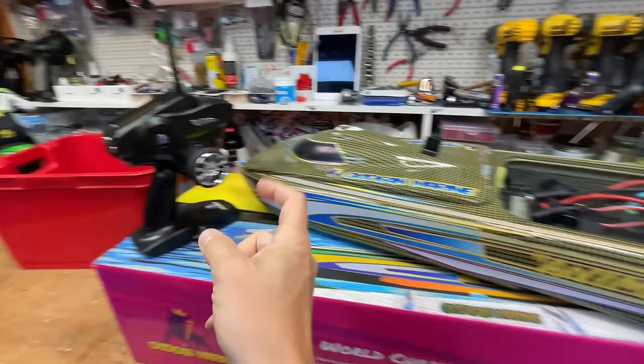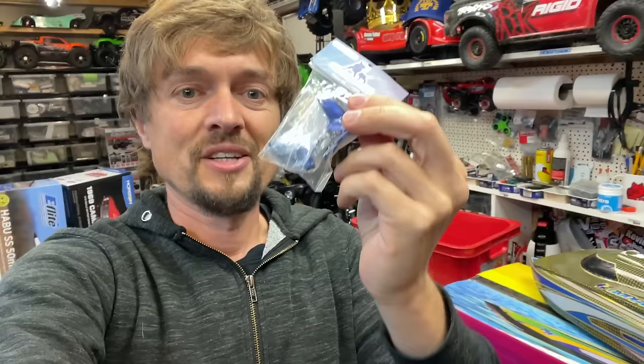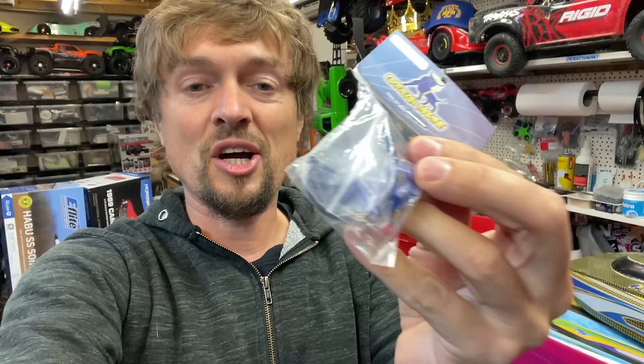Hey! Well done, dude. Now it runs perfectly with these new speed controllers. The throttle delay that we had, I think, was caused by the ESCs being shorted out. Now that we've sorted all that out, it's working perfectly. So here I've got these high-speed propellers. So in the next video, we're going to chuck these on, get the boats back out onto the lake, and see how fast it goes. Hopefully, we're going to get over 109 miles an hour. This is supposed to be the fastest ready-to-run boat in the world.